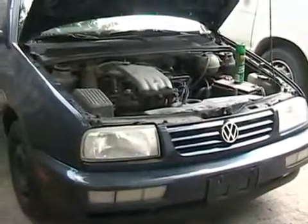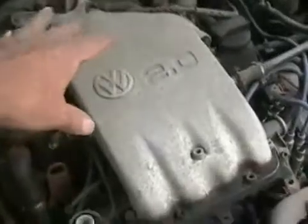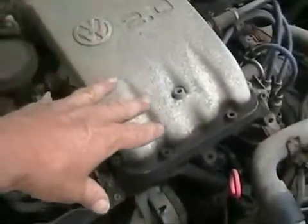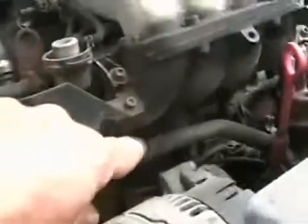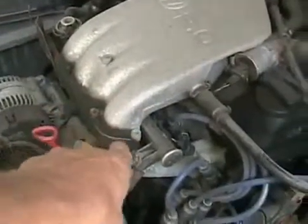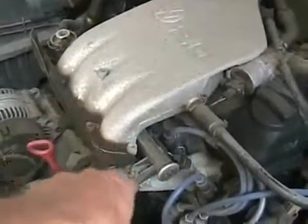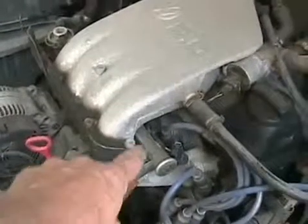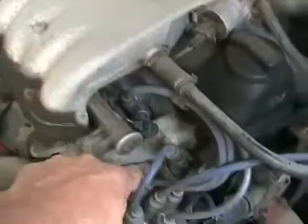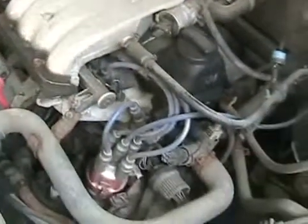Well, anyways, we got a typical 2-liter gasser engine in here, VW style. And this has a combination intake plenum here that gently turns into runners. And the runners continue underneath. To have good, effective, tuned runners for your engine, they should have smooth curves, fairly smooth inner walls. You can polish them and make them better. And the volume from about like here to here of the hole inside in cc's should be close to the same volume as your cylinder is when your piston goes down.